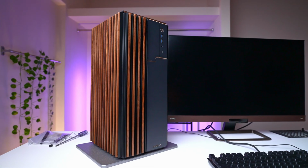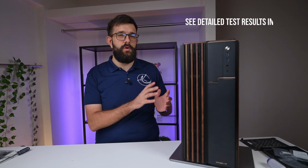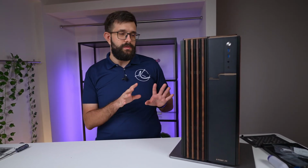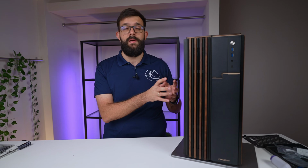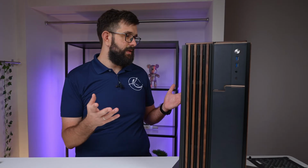With the current setup tests complete, I can say that the CPU is a bit of a hot box right now. It gets hot and it definitely throttles down. The graphics card on the other hand kind of manages okay. So what we'll do next is install a separate CPU cooler to basically offload the heat from the middle of the case to the side to hopefully address those issues. At the same time, we'll experiment with a smaller frame and show you guys how that works and how you have blanking plates and whatnot. So let's get into it.